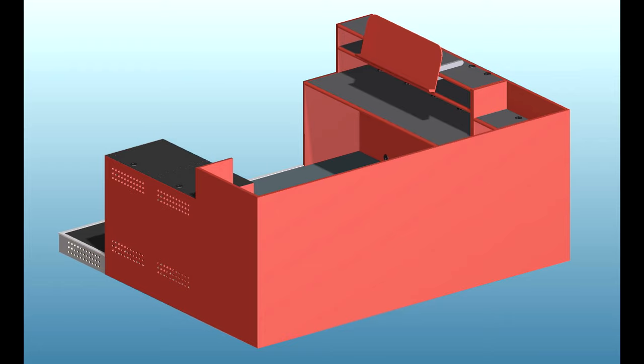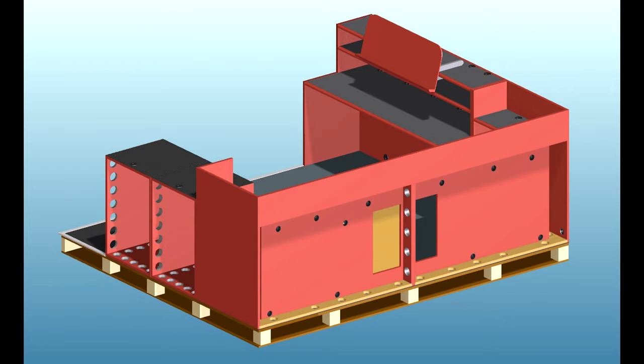This is a view of the rear of the unit with all the covers in place. With all covers removed, the existence of the integral cable chases becomes readily apparent. Notice the two cutouts in the center of the main units. The one on the right is where the computer enclosure backs up to the cable chase, which is now acting as an air plenum. The exhaust air can flow freely into the space and down into the platform space before exiting at either side of the platform through vents at the bottom of the covers. The left cutout is an access port with a removable cover to allow reaching into the rear space to route cabling since there's no direct rear access.